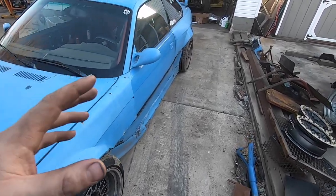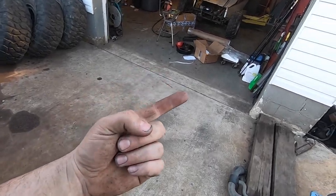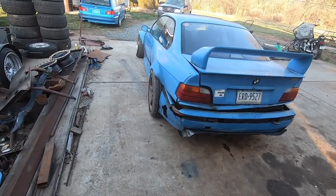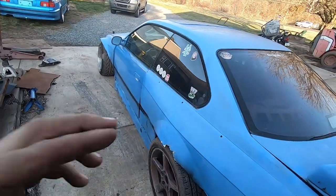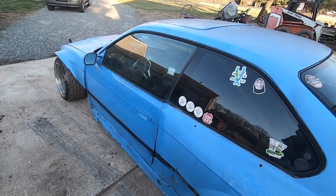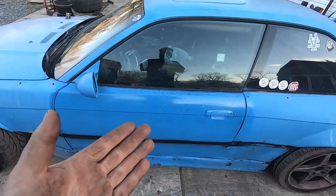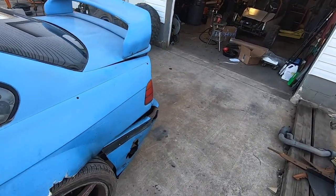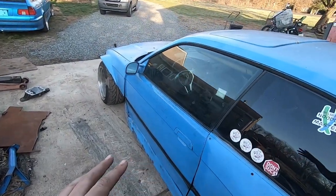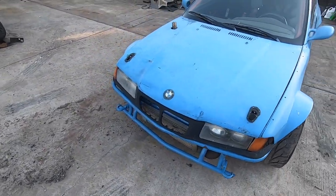There are many ways to shim these diffs - you do not have to buy the diff shims from BMW. There are plenty of other cars you can grab them from on Amazon, super cheap: the eight-and-a-half-inch Chevy, the Dana 80, the Dana 30 pinion shims. For specs, I probably wouldn't follow those unless you're a drift guy. I built this diff very tight to hopefully give it a little extra life in drifting - do not do that for road race; go follow BMW specs. The reason I broke mine in with a fourth-gear burnout is because all the parts are already used - used bearings, used gears, used case. If you actually buy new gears and new bearings you should follow some type of break-in procedure. Thanks for watching Spank Ranch Garage - let me know if you've got any comments and I'll see you next time.